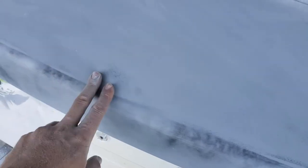Just a couple minutes in, you can already tell. See the spots we have sanded. We sanded this whole area, but I tell you, got some texture there. A low spot here. So just keep working it until eventually everything is just nice and gray and uniform. It's actually this primer is cutting pretty good. The sandpaper is not clogging up, so it should be a pretty quick process.